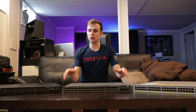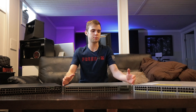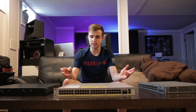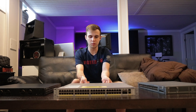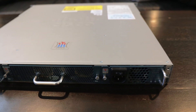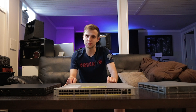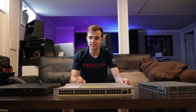The Aruba switch is similar to the Dell — it has 48 gigabit ports and side-to-side airflow. It only has one power supply, similar to the Dell. But instead of stacking on the back, you have console and management ports for out-of-band management and console over USB. It also has a USB port for plugging in a flash drive and flashing firmware, plus a screen on the front for changing settings and resetting the switch. The Cisco switch is kind of the big dog — the biggest switch out of all of these — with dual hot-swappable power supplies on the back and a removable fan tray.